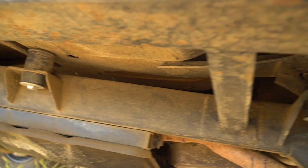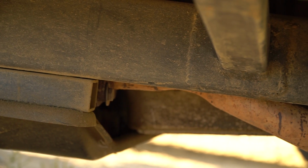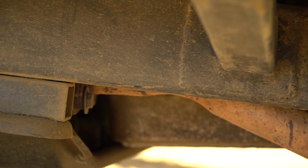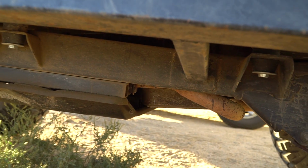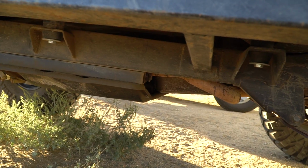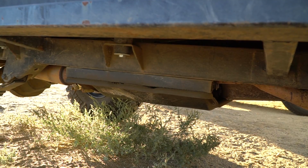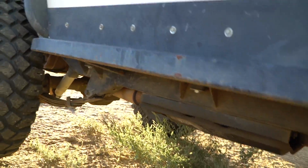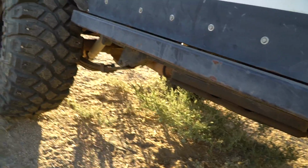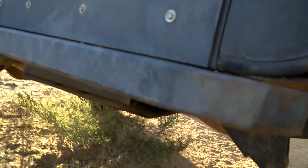And those guys are, as you can see, directly welded to the frame, and the frame has been sleeved for extra strength. I'm gonna zoom in here, and I know the Jeep is extremely dirty, but hopefully you guys can see. Right over here we have a transmission pan that's aluminum. It's extra deep, holds I believe 2.5 or 3 quarts extra transmission fluid. It helps it stay cool with these big tires. Magnaflow catalytic converter is hiding right below the transfer case skid plate. We are running an NP 231 transfer case with Tatten driveline, custom drive shaft, both front and rear.